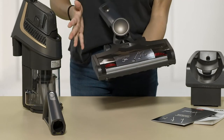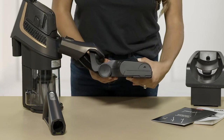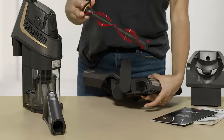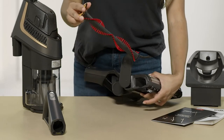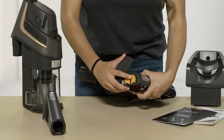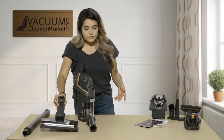An amazing feature about this vacuum is you can remove the brush roll. There's a little locking mechanism — you push that to the side, then you pull up the front panel, and there's your brush roll. Go ahead and pull on that and it removes completely. So if you have hair tangled around it, you can remove it, get all the hair out, and then put it back in and continue cleaning. To put it back in, just push it in, shut your vacuum, and lock it back in place. Super nice feature that Miele created.